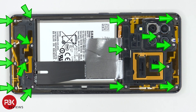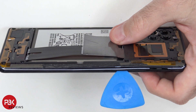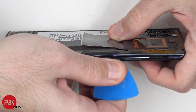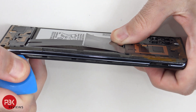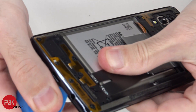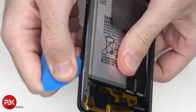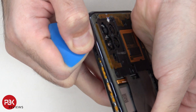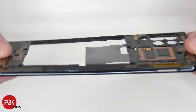There are 16 Phillips screws which need to be removed. Once your screws are removed, you're going to put your plastic pry tool in between the housing and the frame of the screen and pop the catches around so you can separate the back housing. Here's your back housing and it is plastic as well.